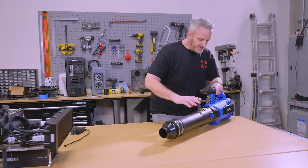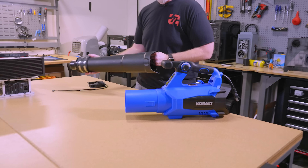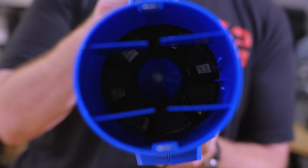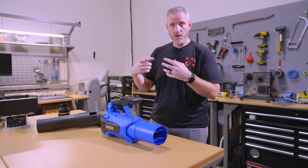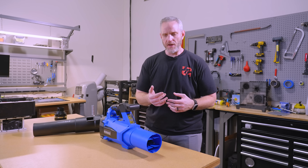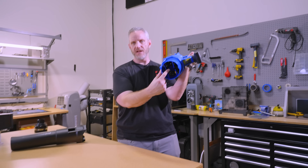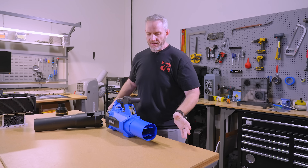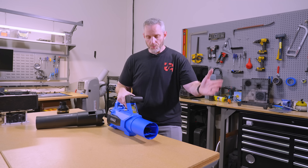Then I noticed this is not a turbine — it is a turbofan, an axial blow-through fan. The idea is this super-fast 12-amp motor just spins the crap out of those blades. The air gets pulled in through the back in a straight-line airflow. It's even got the jet-style cone on there for aerodynamic reasons as the air passes through, and as the air is leaving, it's pulling other air with it to increase velocity. It's just creating this straight-through blow design that is not getting warm.